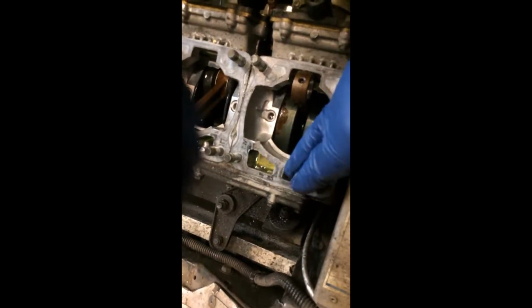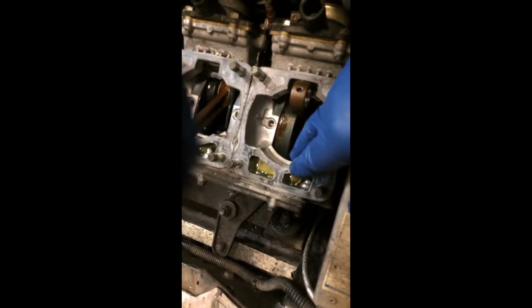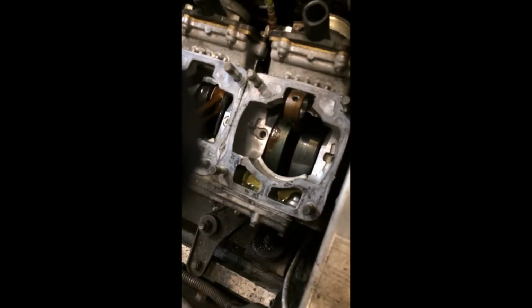So I think this base gasket was leaking into this cylinder. Now, why are all the rest of the cylinders wet? Well, the charge is in the crankcase, and there isn't any seal between each cylinder. So the charge is what it is inside it. And they share the charge, sort of, because there are open bearings in there between these. And the bearings, of course, the charge will go between them. But they're high enough up that if there was water laying in the bottom, it would stay in this one and not in the other two. But when you started it, of course, all three would get a nice blast of glycol coolant. So I'm thinking there's our problem right there. That is Captain Obvious right there.